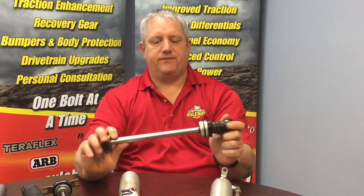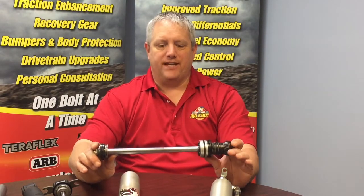This is a lot more expensive to manufacture, so the price is going to go up a little bit. The advantage to the monotube shock is that we're going to have better dampening ability, and while that may not translate into a softer more comfortable ride, what it does translate into is the tires touching the ground more consistently over bumps. This means more control, so that gives you safety — and that's a really important feature especially in a dual-purpose vehicle.